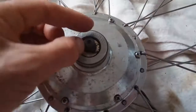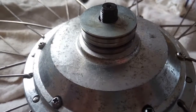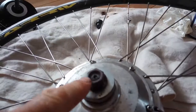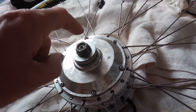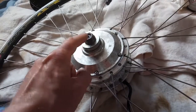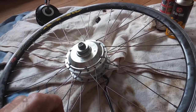You see how it's got the sort of flap profile that holds onto these axles. I've put a great big washer to hold the actual thrust bearing there. It's not a sealed bearing, so it's not the best for a wild environment. They're not going to be brilliantly tied on because the wheel is going to be going that way - I'll have to find another way, maybe tack or lock that off somehow, drill through it, spline it, something or other. So there is a wee danger that would pop out eventually - I'd have to keep an eye on that. But the compression this can take now, the load that the axle is going to take is massively increased safely. The rim would break off before this - hopefully the rim would bend or give. See how it goes.